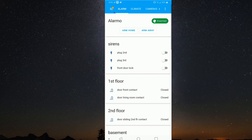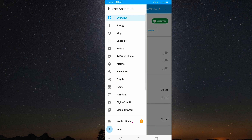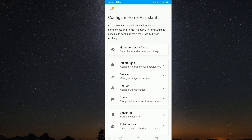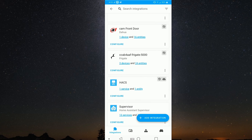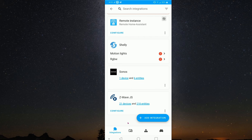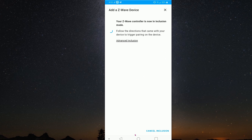Once you insert the two batteries, go ahead and start up Home Assistant so that you can add the device in. I'm using my mobile phone, so I'm clicking on the menu icon to open up the menu. Scroll all the way down to Configuration, go to Integrations, then go all the way down to Z-Wave.js and click on Configure. Click on Add Device, click on Advance, and then click on Legacy Secure. Under the device itself, press the pairing button three times — one, two, three — and then it should add.